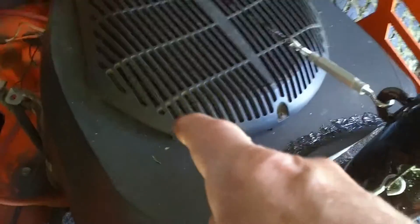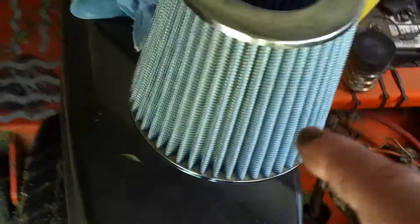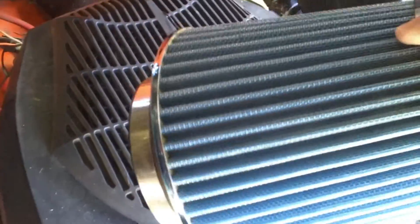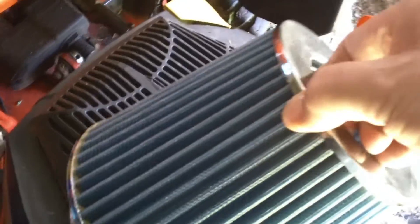So this piece-of-crap Kohler engine will live longer. This is the APC air filter — I just coated it with Yamalube, which is Yamaha's air filter oil. It has a lot of sticky stuff in it and I'm preferring it over K&N filter oil because it's so sticky — the stickier it is, the more dirt it captures. That will just fit right up here on top.